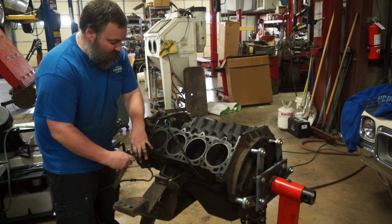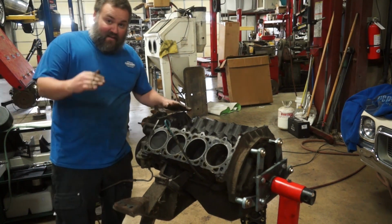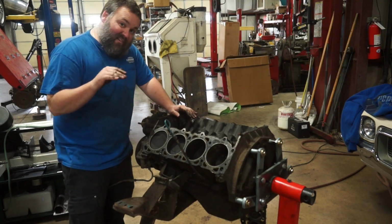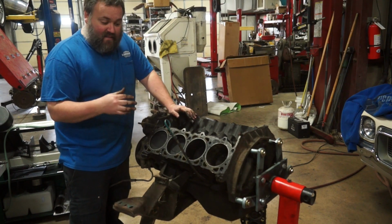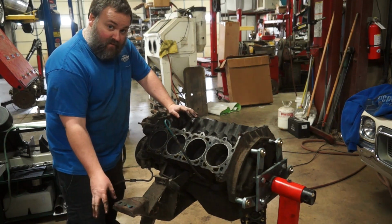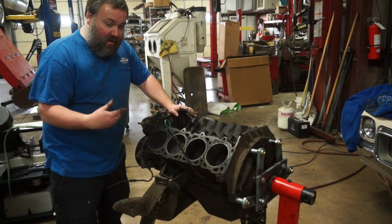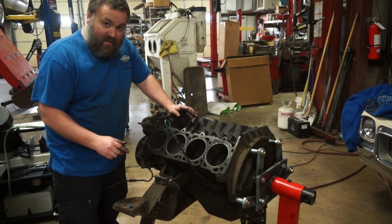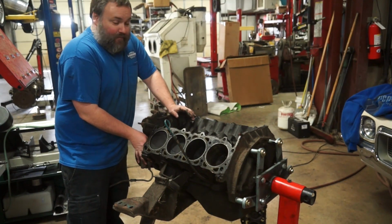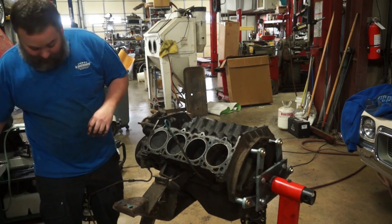And with the aluminums, a lot of times the phrase would be like, you could start the aluminum on like a tier, like a level 6, versus you could get these to like a level 8. So the aluminum is going to be better, generally speaking, than even a pretty well upgraded cast iron head. And depending on how much time and money you spend on porting and polishing and all of the extra fun bits in the heads, sometimes it can actually end up being less expensive. Depends on the brand. Some things you can do that with, some things you can't.